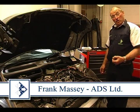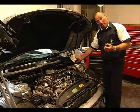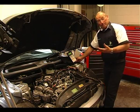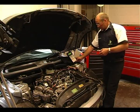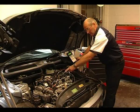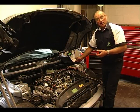Welcome back. I'd like to introduce the next concept of testing using this tool, provided by one of our partners, Dow & Diesels. This allows me to interface with the high pressure pump by interpreting or interrupting the signals from the PCM. It has essentially three functions: a simple gauge to measure pressure via the pressure sensor; it allows me to drive the pressure control solenoid, which in our case is in the rail; and the volume control valve, which is on the low pressure side of the high pressure pump. So we can control all these devices independently of the ECU and therefore prove the integrity of the high pressure pump.